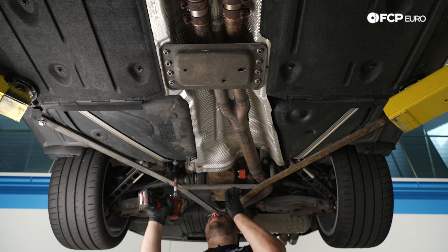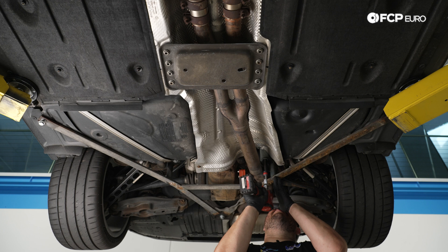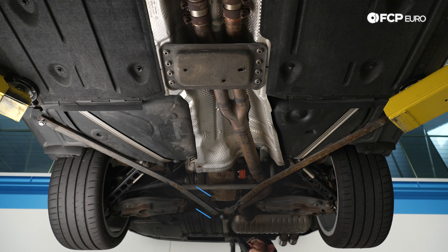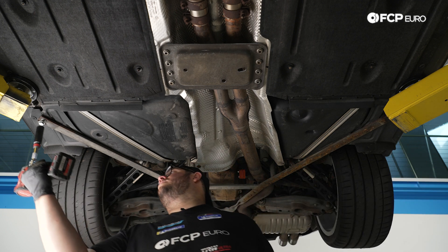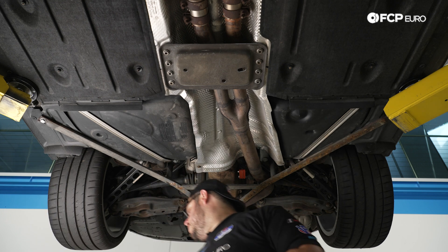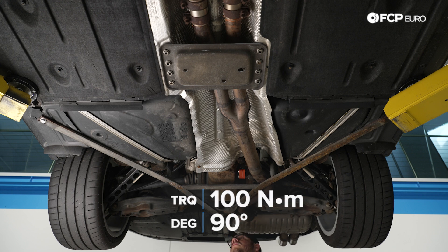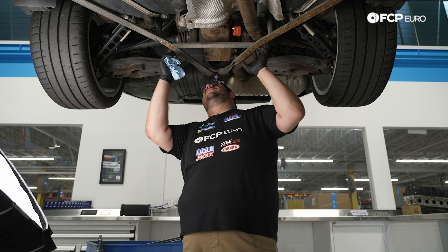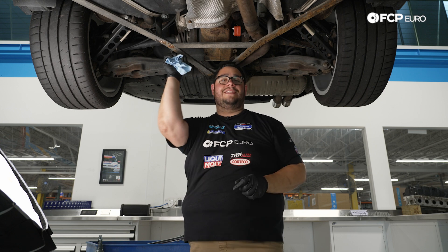We have two M16s in the middle and M18s on the ends — one in the center and one on either end. Using the torque wrench, set it to 100 newton meters then do an additional 90 degrees (a quarter turn) on each one and we're good to go. With those secured, install the last couple of plastic splash shields.